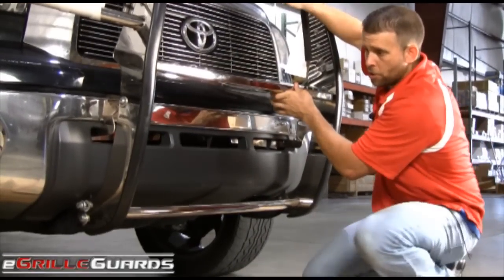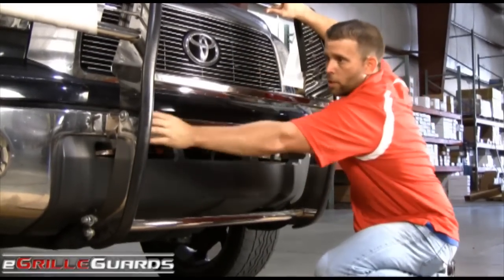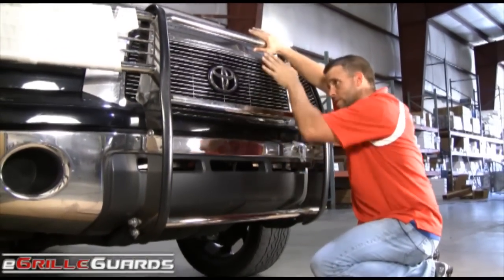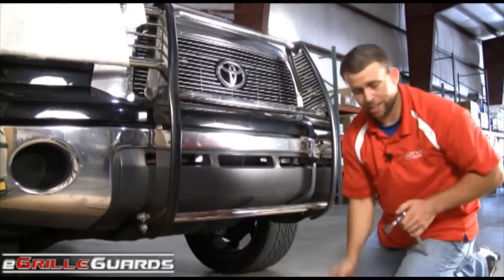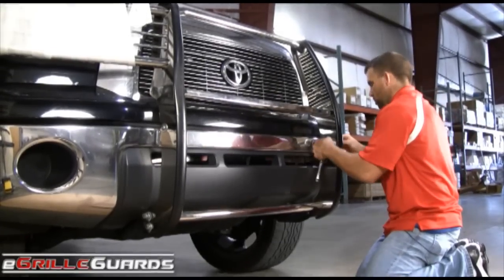So now we've got this tight — we're actually going to push this forward, and you're going to feel a little tension on doing this, which is what you want, so that way it's easier for the grill guard to hold position. Make sure it's nice and even and contoured with the actual vehicle. You're going to put that in place, and then you're going to use a 17-millimeter socket and a 6-millimeter Allen wrench, and then tighten up the support straps.